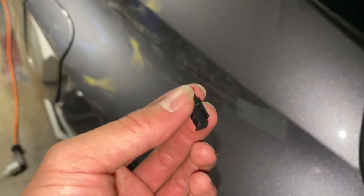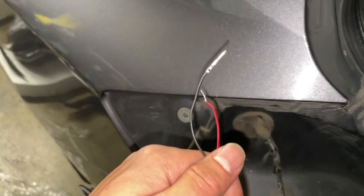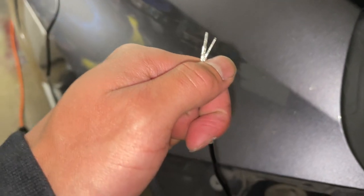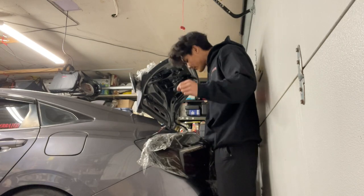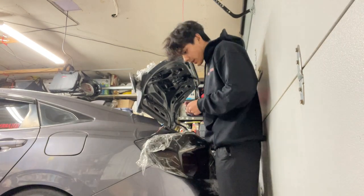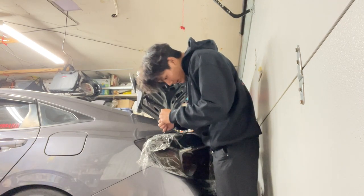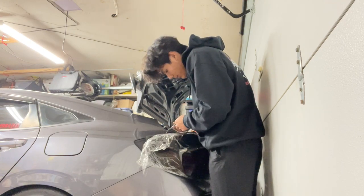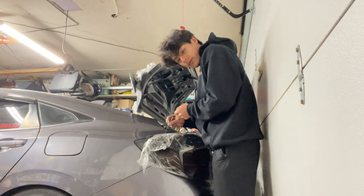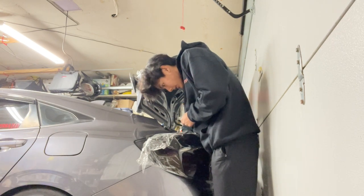Okay, folks, I just removed the connector from the plug wires, specifically this one hanging out from the hole. Now without the connector there, we can go ahead and slide the seal over this to the black part. Okay, guys, so here is that little cover we drilled a hole into. We're gonna go ahead and stick this in one at a time if it doesn't have enough clearance, but actually both of them fit at the same time. And then we're gonna keep pulling it until this black wire cover is fitted in there. Now I'm gonna go ahead and place the cover back where it originally sat.